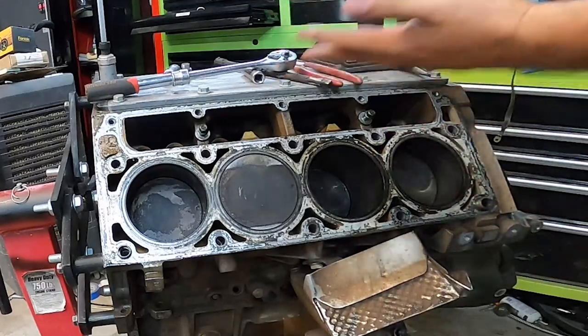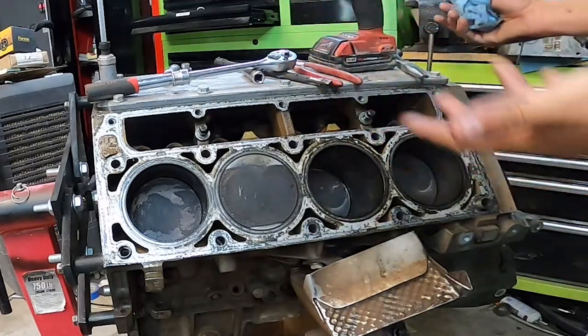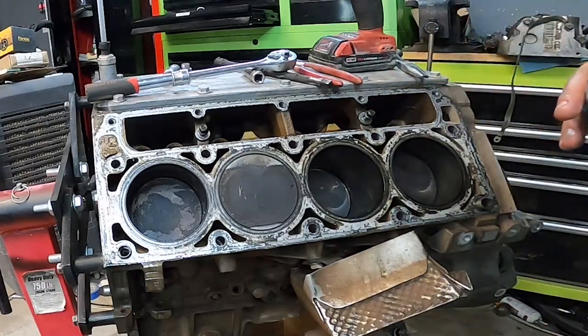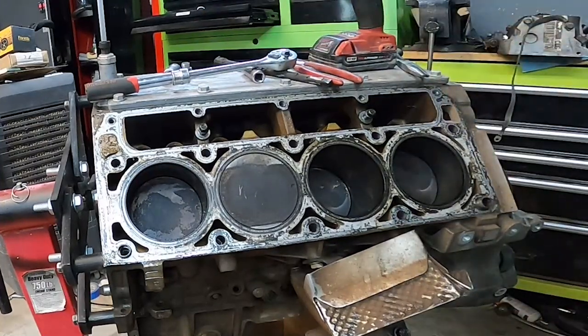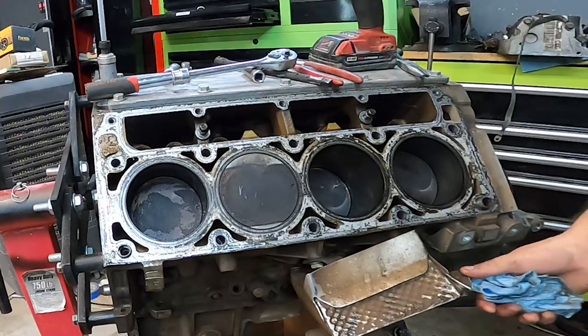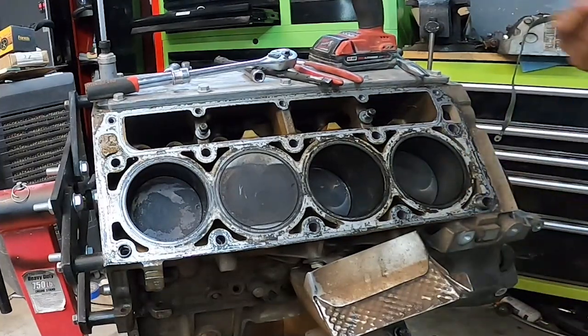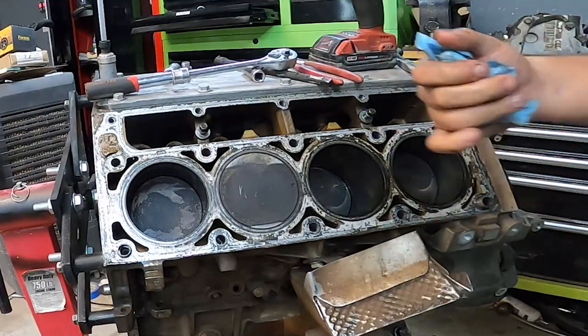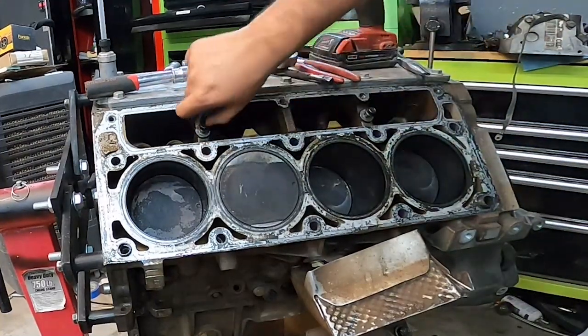BTR had that one cam. I don't think it was a good cam. I don't know what was wrong with it, whatever. I couldn't get a good vacuum signal. Like, my brake booster always felt low. And then I had a hard time just getting it to idle correctly. And like I said, I'm a bad tuner. But normally I can at least make them idle and run reasonably. This one just never really wanted to run right. So, you know, it could be other factors as well.